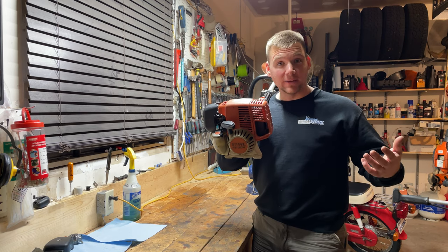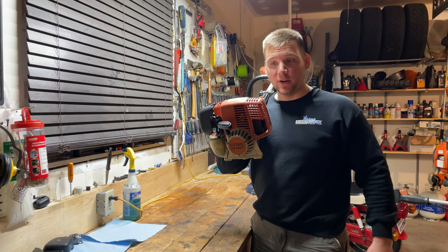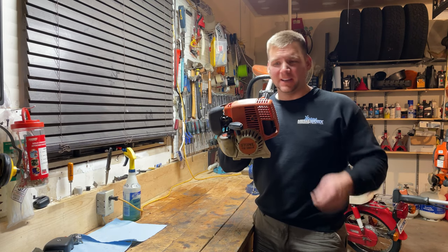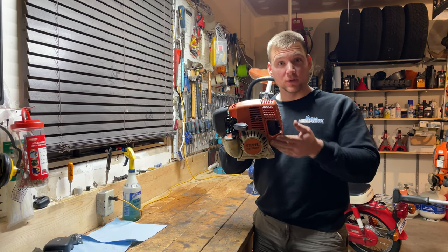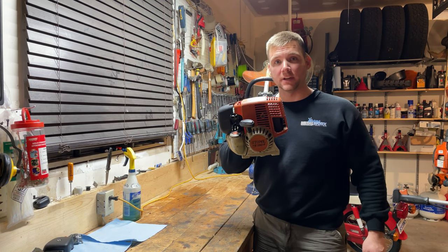If you're a pro level user, like most people buying something like this, and you're using it every day or it's part of your livelihood, you probably want to check it a little bit more often. And when it starts to act up a little bit, or if it's hard to pull, like the issue that I was having, it's a pretty safe bet that there's something going on with the valves and it's worth making that adjustment.